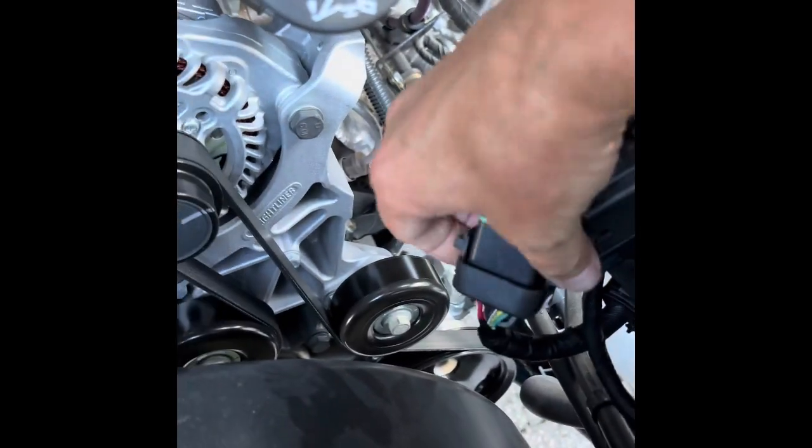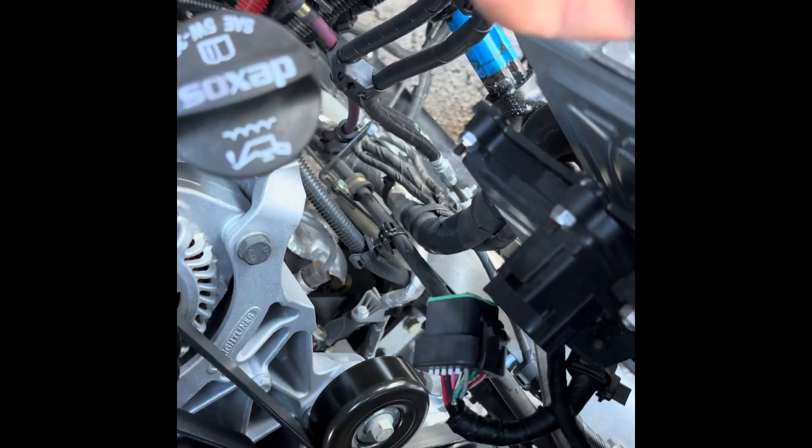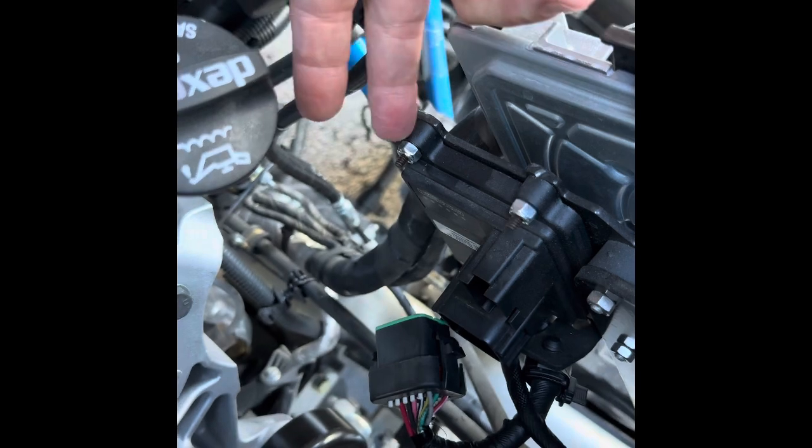It takes a little muscling but you pull the bottom one off and then the top pin off, and you literally just let them sit for 30 seconds. What you're doing is letting this module here reset.